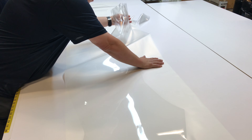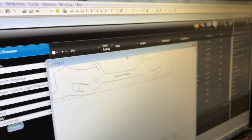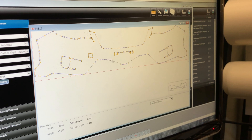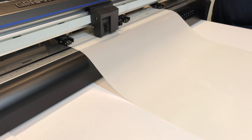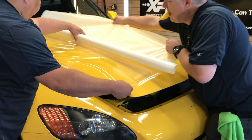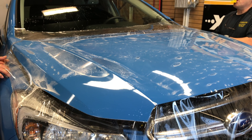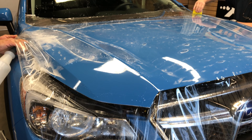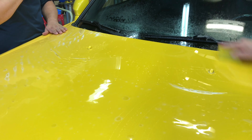Next we move on to cutting the film for the desired body panel. This itself is a bit of an art, and Expel provides two-dimensional cut patterns which, in combination with the film's ability to stretch and compress, allow for fitting it over three-dimensional curved body surfaces. You can also manipulate these designs for custom fittings. A plotter cutter is used to cut out the patterns — a very cool printer that cuts the film to the exact dimensions specified on the computer. The body panel is sprayed with soap and water, and after removing the release liner, this soap and water allows you to position the film in the desired location. Once positioned, an alcohol-water mix is sprayed underneath to remove the soap and water and give a clean surface for the film to adhere to.